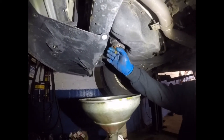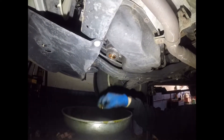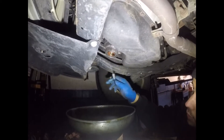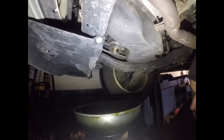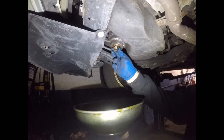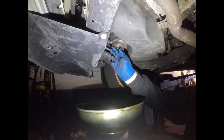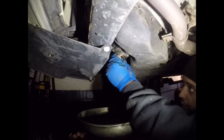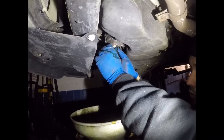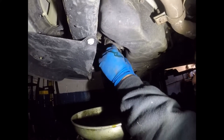Now that the oil filter is finished draining, we want to remove the drain tool. We want to remove that oil seal. It's going to have a little notch on the side. After this, we want to put the new one. Make sure that you lube a little bit on the outside. This one doesn't want to stick there, but some of them they stick on it. When this happens you just have to hold it a little bit so you can put the cap back.